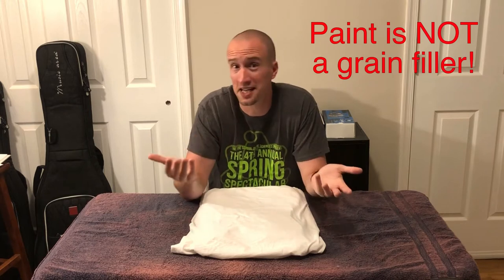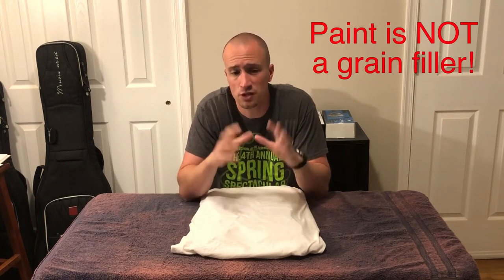In actual fact, I put on five total coats of primer and three total coats of top coat, hoping that by that point I could build up enough paint to then sand it back down to a flat surface. And because I did that, I let the body sit for a full week before I even thought about it again, because I knew I had so much paint on there and wanted it to have ample time to dry.